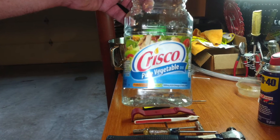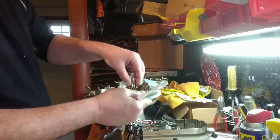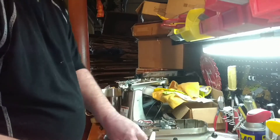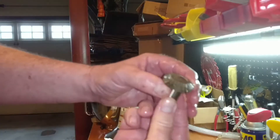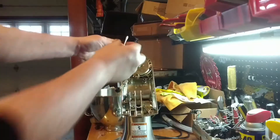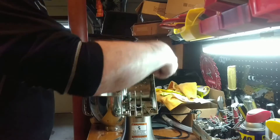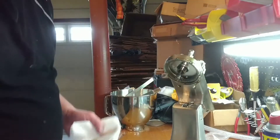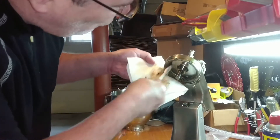It's really the only good way to get everything completely cleaned and ready for new grease. I'm going to use Crisco oil in a little pan to soak all the gears and loosen up the crud, then brush them down with a toothbrush. That lets me get into all the little nooks and crannies. There's the planetary. Then I take a q-tip to get all the detailed gook out of the machine, and use the toothbrush again to clean the lower gear assembly.